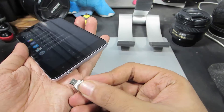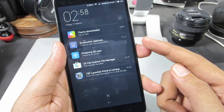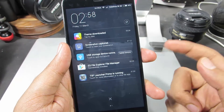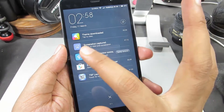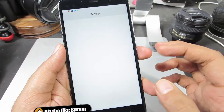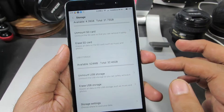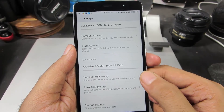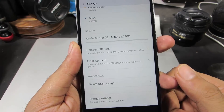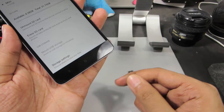So let me just remove that and insert it once again. And now as you can see we are getting a notification saying 'Repairing SD card', and once again we have the option to safely eject our OTG pen drive. For some reason if you couldn't find that option, just go to Settings, scroll down a little bit and select Additional Settings, then select Storage. If you scroll all the way to the bottom, you have the option to unmount USB storage. Just select that and press OK, and once your OTG pen drive is ejected properly, you should see this option — now it is safe to remove your OTG pen drive.